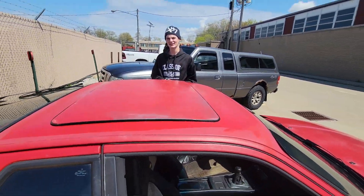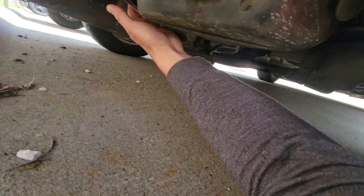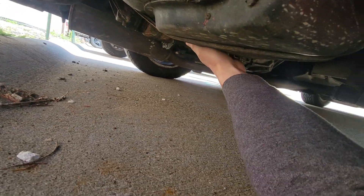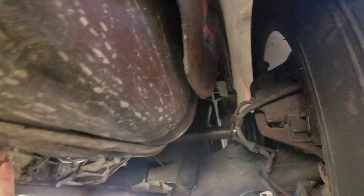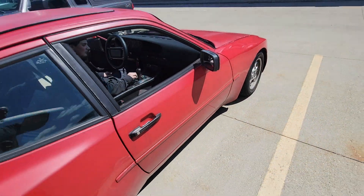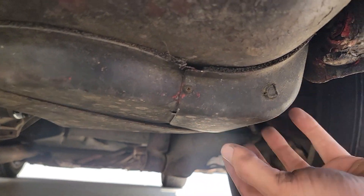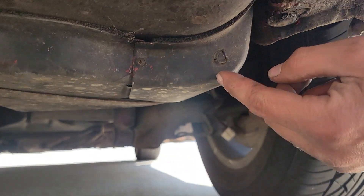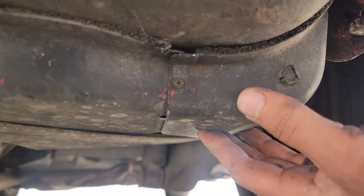If it is the fuel pump, luckily I think it's pretty easy — it's external from the fuel tank. When you turn the key to the run position the fuel pump should turn on, so let me get down and take a look. There's a possibility that the fuel pump is underneath this cover, so we may have to move the cover to get to it. He's going to turn the key on and see if we hear anything.